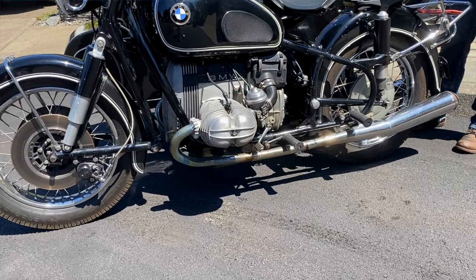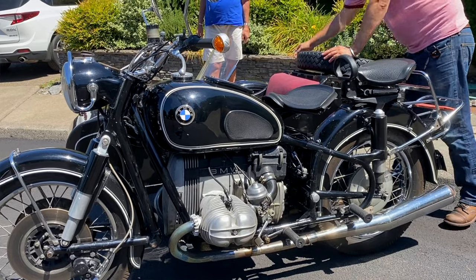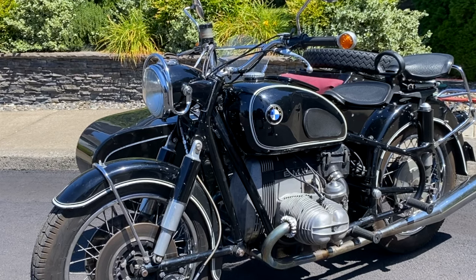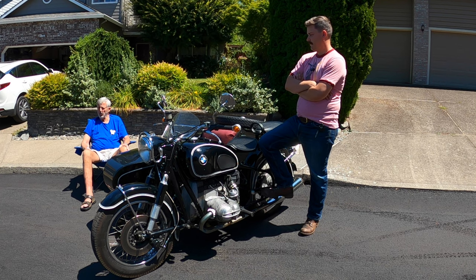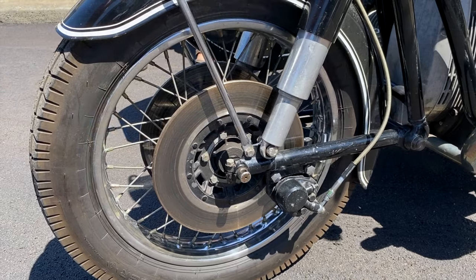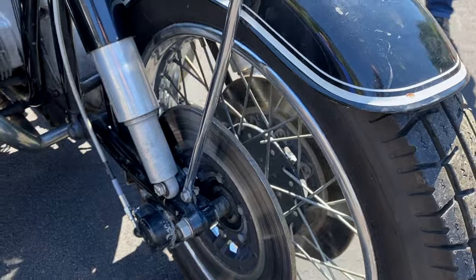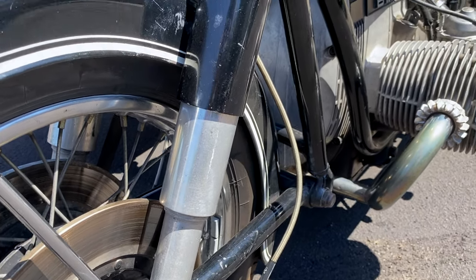What you see here is the result. It started life as an 800cc motor; 1000cc jugs were put on it. As you may examine later, it's quite a tight fit in the frame. The exhaust represented a few problems, mostly with drivetrain issues. One of the most important improvements he made was the twin disc front brake, grafted off of a Japanese bike — he had hundreds in his inventory, being a salvage yard. The brakes are amazing. I've seen a lot of other conversions — the R75 motor was a really popular one — but most of those have drum brakes. We've got dual discs here, I believe from a Yamaha SR500.